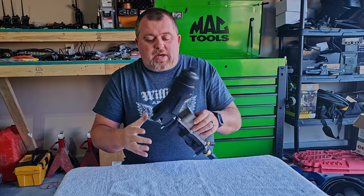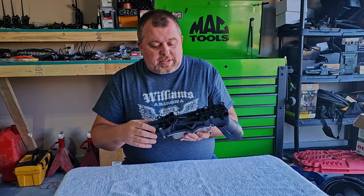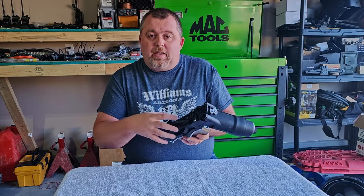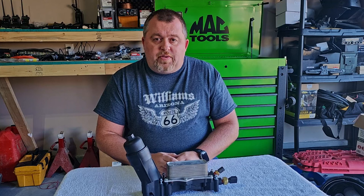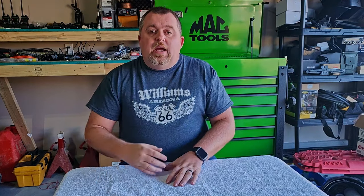What we end up doing is pulling this out. You could either get an upgraded gasket kit and simply fix the one you have — you can pick those up at just about any parts store for 20 bucks — and then put it all back together and hope that it doesn't leak. The downside is that if the plastic itself has become brittle or has expanded too far, even brand new gaskets won't necessarily seal it. This is the one that came out of my wife's Jeep; I got it all cleaned up for the purpose of the video. There are a couple of companies, including Dorman, that make a replacement oil cooler assembly that is all aluminum. However, they're extremely difficult to find. When we went to replace my wife's JK, we could not source an all-aluminum oil cooler no matter how hard we tried, and the ones I did find were so expensive it really wasn't worth it.